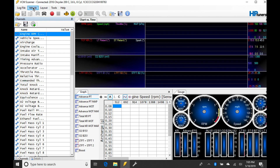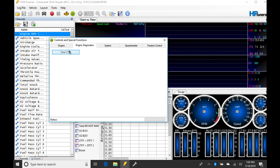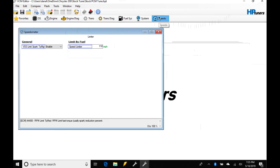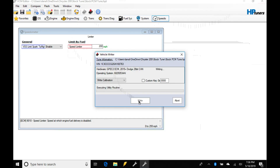Let's get back into the car, turn on the ignition — we don't start the car — and scan it for error codes and clear any error codes if they're there. Everything is installed and running. The first thing we're going to do to verify we can write to the PCM is remove the speed governor. On my car the speed governor is set to 118 mph. We're going to go in and change it — you can change it all the way up to 255 miles an hour in this software. We're going to set it to 200, knowing the car will never reach that, but essentially by going so far up we're removing the speed governor.